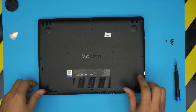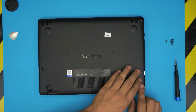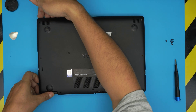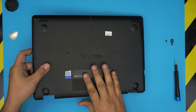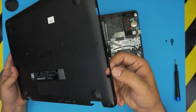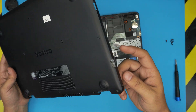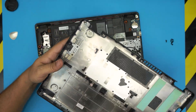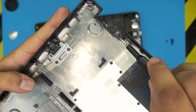Once you've done that, close the laptop and put your hand on the hinge by the RJ45 side — it's important you do it on that side. Lift up a little, grab the front corner, bring it up and twist it around. Then shift it over towards the VGA side so you can unhook the plastic right under the headphone jack — otherwise you'll break it. These are the C-lock clips I'm referring to on the bottom cover.